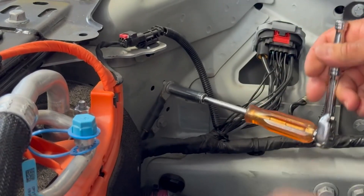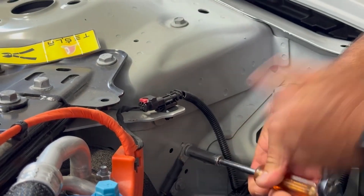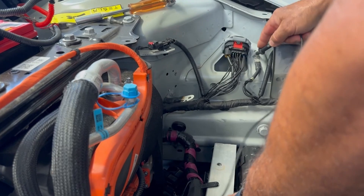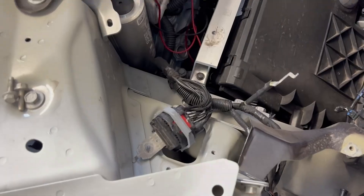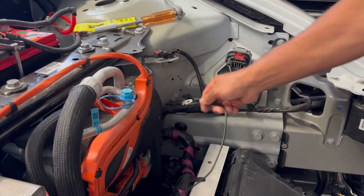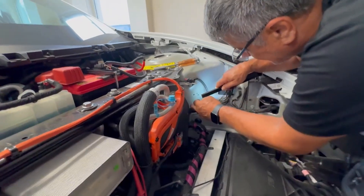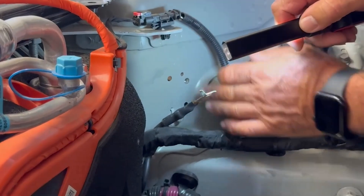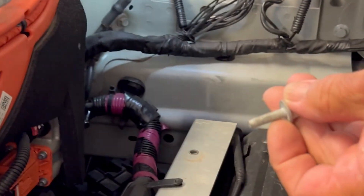I'm trying to work out where this wire here is grounded, because it can corrode apparently. They're all a little bit corroded - all the grounding wires. No matter what, I'll put it on ground and I'm not getting any ground. So these two here are the two steering wires. You can see there's not a lot of bare metal - it hasn't been cleaned that well, there's still paint under it.